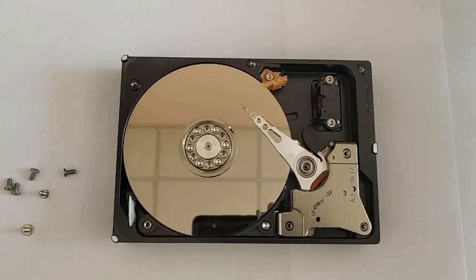In each of these possible scenarios, the magnetic heads lack the time they need to return to the safe landing area and get stuck to the platters' surface. Now it is only some physical action that can help get them back to where they originally belong. When the heads get stuck, it is accompanied by a typical sound like short beeping repeated in cycles.